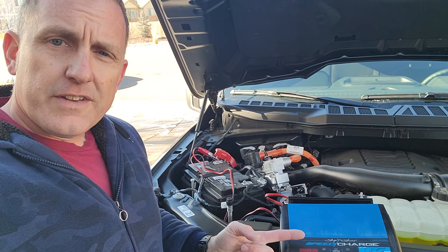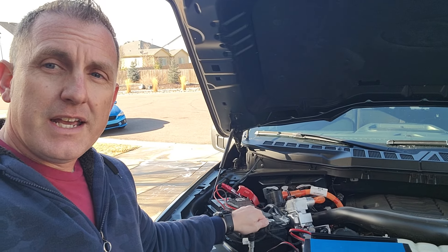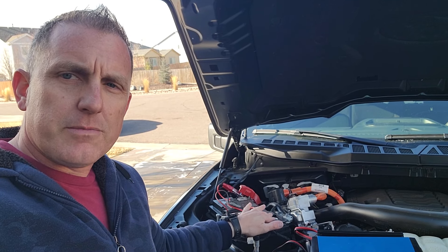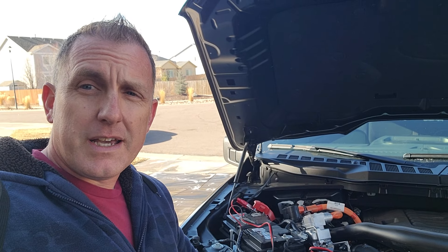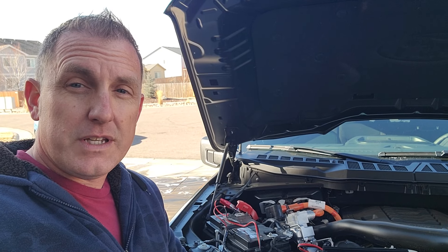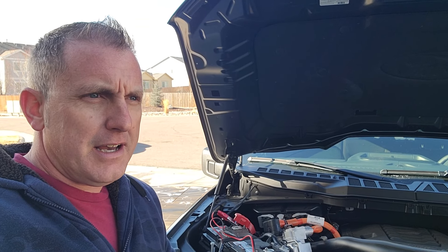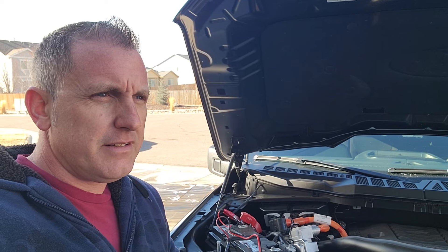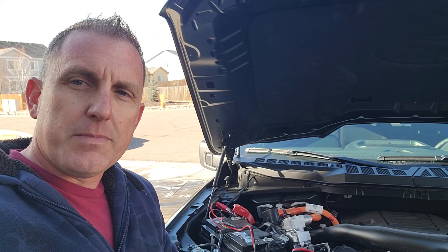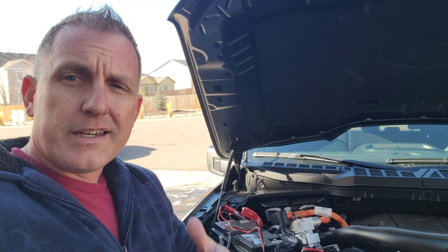When you get all that hooked up to your charger, I guarantee this is going to charge about 10 times faster than if you tried to just hook it to that standard post. In fact, I'm not even sure you'll get a 100% charge going through that battery management system. Hope that helps guys. This should work on any F-150 — I think after 2012 they started doing this — and it's going to apply to just about any vehicle. Chevy's had their version too, with a different acronym. Lots of different names, but just hook it up that way, charge it, and you should be good to go. We'll catch you on the next one.